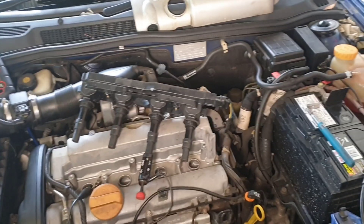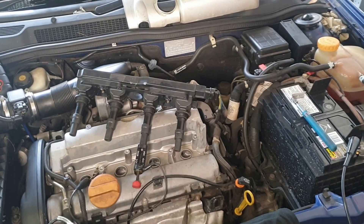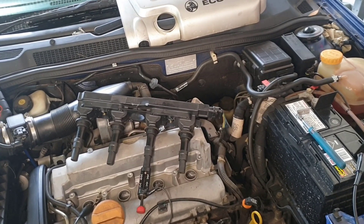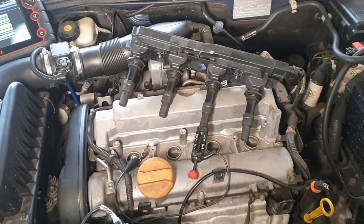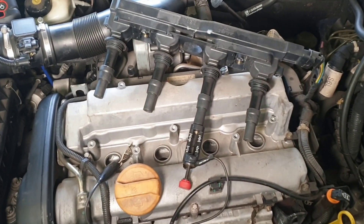So I went to manually testing the thing. You could really, if you wanted to, try and catch it through the scope and be able to see the difference in the burn time and things like that via the primary side that we were scoping. But I think in this case, just take it out and mechanically test it. So I'll show you why it's important to do this test with a couple of extra steps.